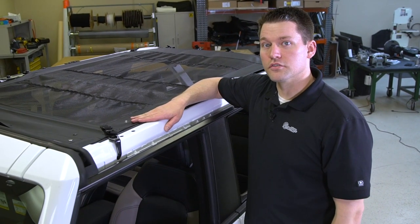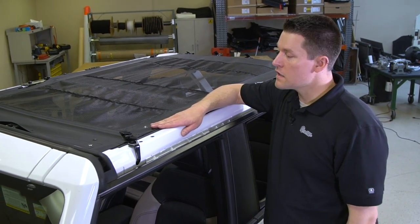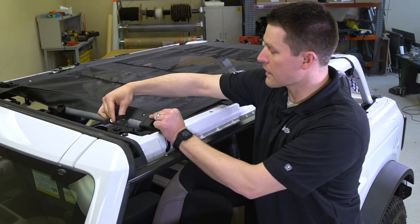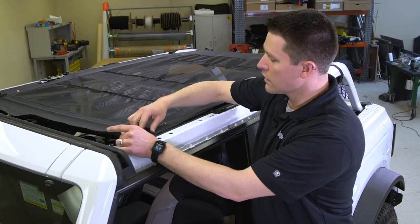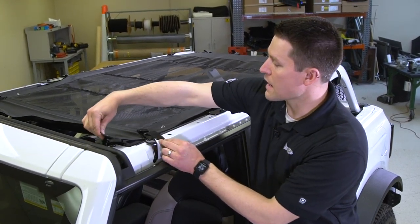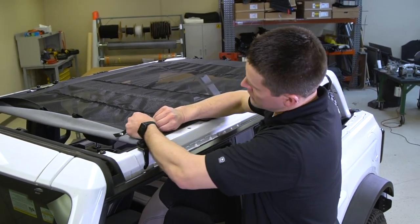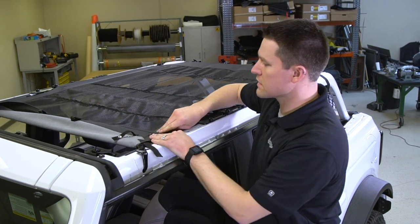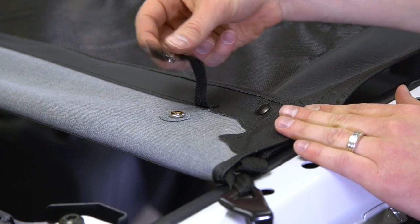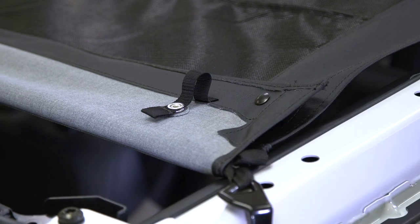If you have this installed you can keep it installed underneath either a soft top or a hard top. To do so, release the hooks and the strap that came through the receiver on the inside. You're going to want to let a little bit of tension off on the front corner, and then the top itself actually comes back and snaps down — that's what's going to hold it in place, allowing you to get to the receivers at the front of the vehicle. With the top back, go ahead and take that retention strap and snap it back to itself on both sides.